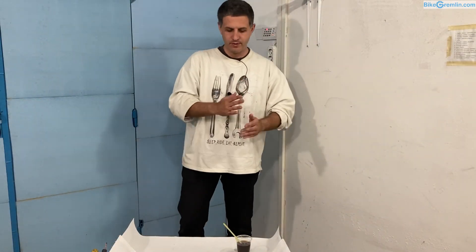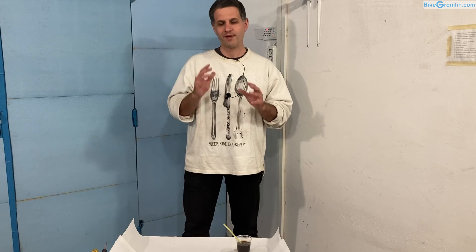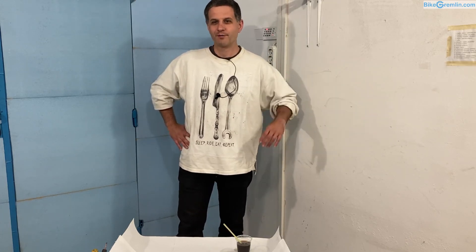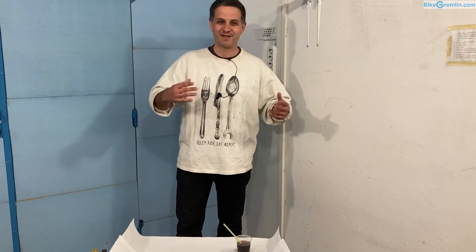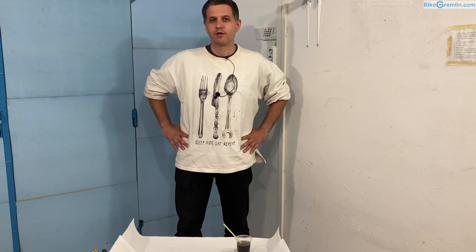This is the basic principle and it comes in very handy when shortening brake hoses, for example, allowing you to do that with practically almost no air inside and to easily remove any air that does enter — minimizing that as much as possible. If you pay attention to what end you open and what end you keep closed, it works well. I'll make a video on that when I find the time and when a bike that needs that operation comes in. But I think it was a good idea to make this video and explain the working principle. That's it — thank you for watching and cheers.